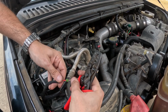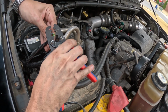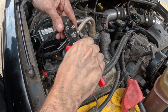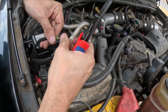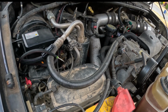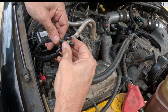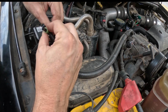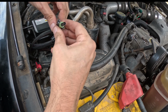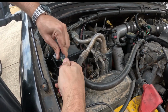Now I've got my green seal all ready to go. So that just goes in there. And then this will kind of lock that in position. Then I grab the male side of the terminal and basically push it in until it locks, and then fold the rear over. So now I have a good connection there, and then it's nice and easy to make my watertight connection.